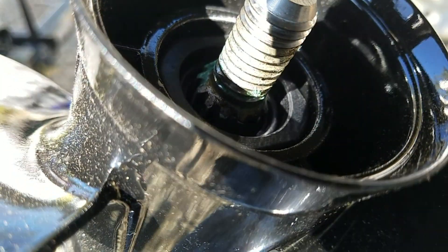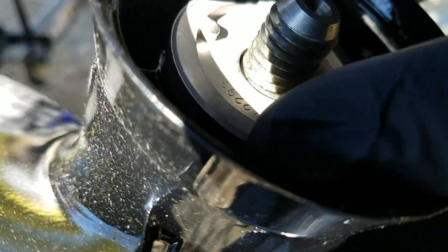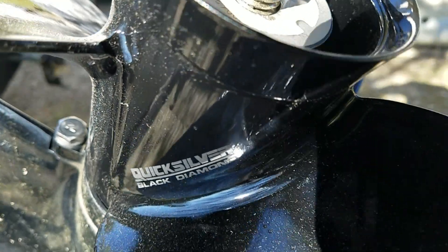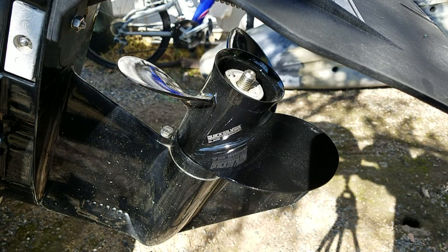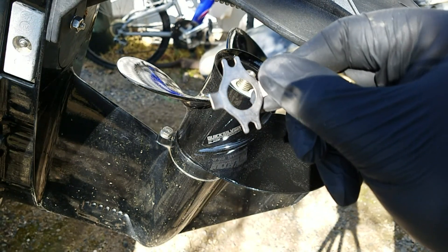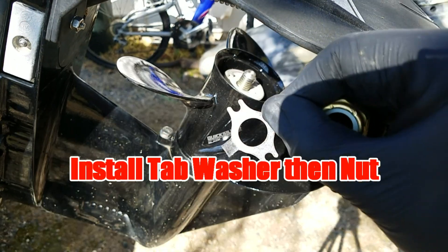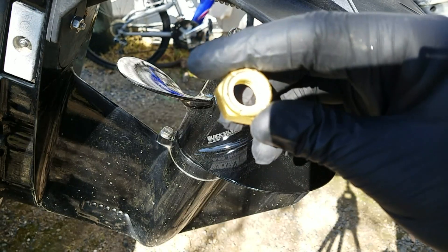You can see there's a lot of grease on there. So we're going to go ahead and put this on until it's lined up. And it's actually splined as well. So that's basically on there. The kit comes with a new nut and it also comes with a new locking washer — I guess you'd call it — with the tabs. The tab washer goes on first, and then your nut goes on second.